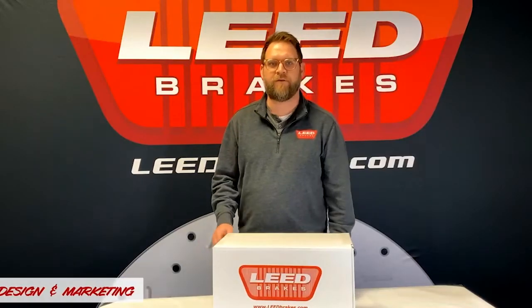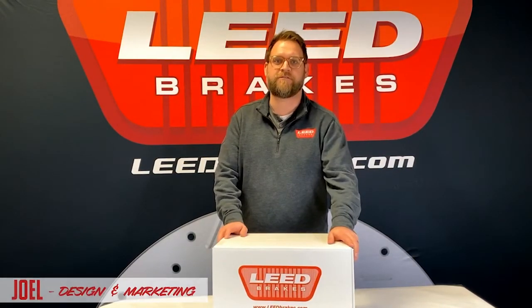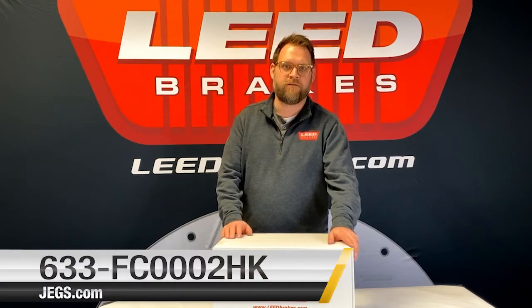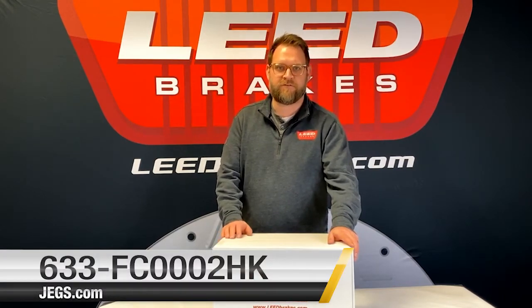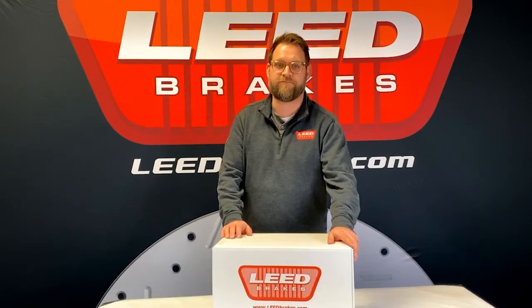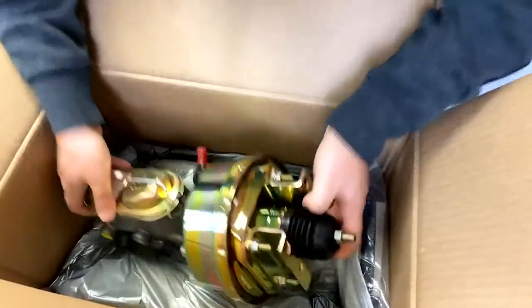Hi, I'm Joel with LEED Brakes, and this is our power brake booster kit for 1964.5 to 66 Ford Mustangs with automatic transmissions. It's part number FC0002HK. This kit will also fit manual transmission cars using an aftermarket cable style clutch. You'll see that we've pre-installed and pre-adjusted the push rod to help make installation easy.